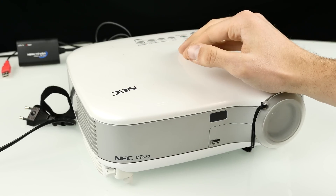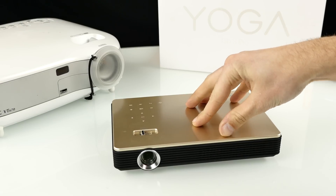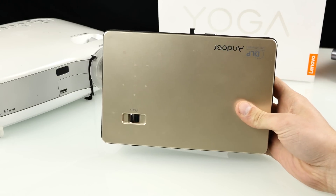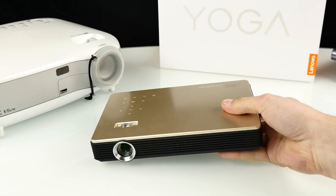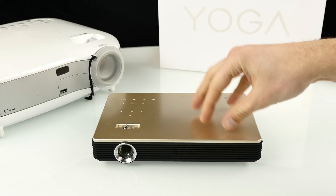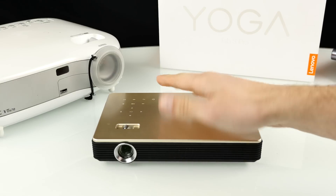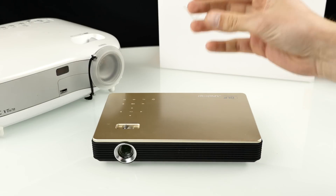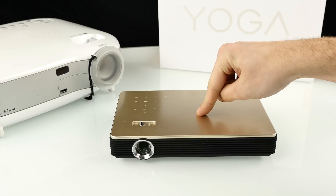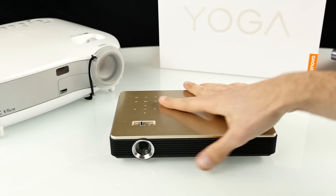I will show you the projector we're using right now — this is actually my office projector, because a lot of people ask me what projector I have. I'm actually gaming on this one here, and it's incredibly small. It's a digital light processing projector, invented by Texas Instruments. It has a DMD chip, an optical semiconductor — basically a field of an array of microscopic mirrors that act like a light switch. They can tilt and reflect the light, giving great fidelity and great colors. Even though the lens is so small, it has on paper 1000 lumens but it's way brighter than this old 2100 lumen projector, which is really incredible, and even the resolution is better.